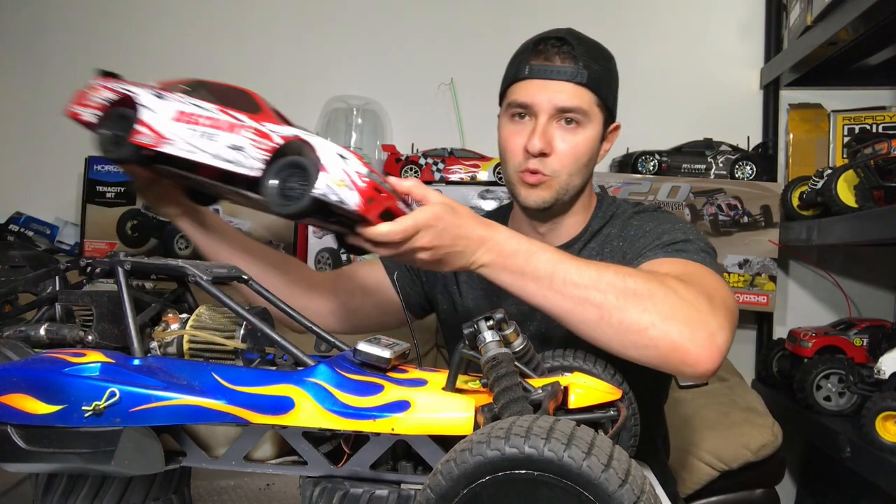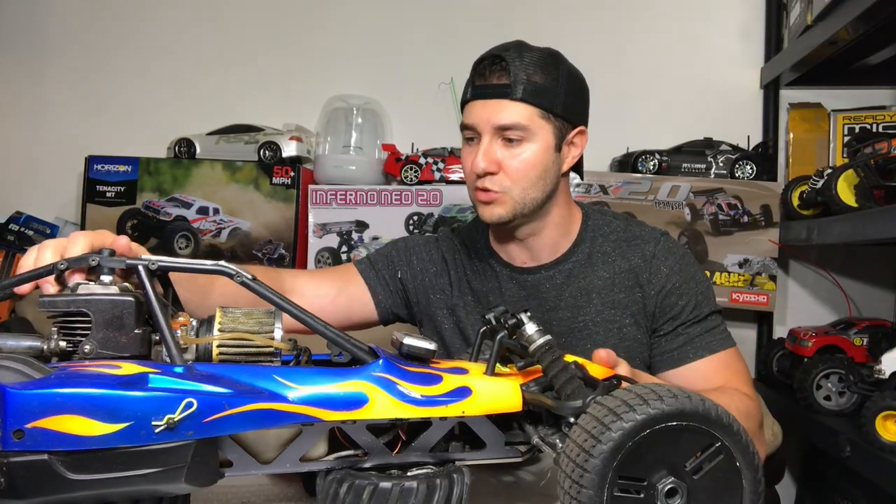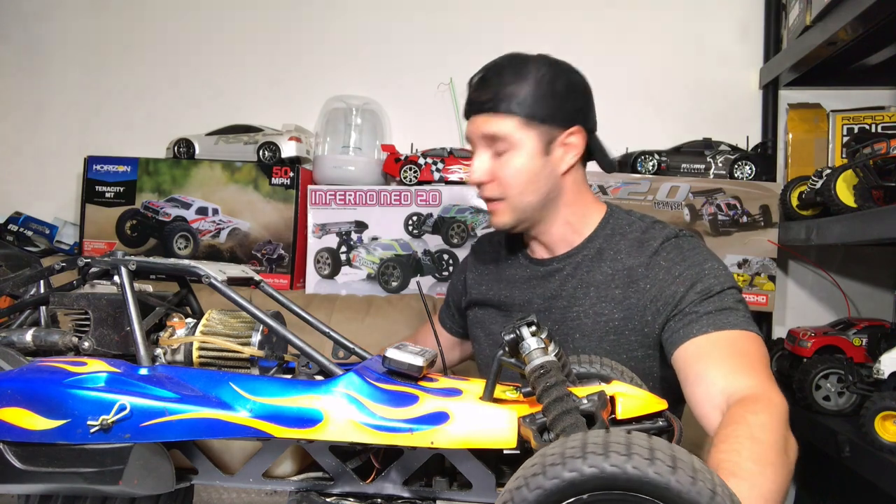The other day I was just idling this Baja and it just shut off on me. I started to worry — is everybody actually right, does this thing only last about a gallon? I paid only $12 for this carb on eBay and it's been doing good so far. But is it possible it only does good for about a gallon then dies? I observed fuel in it, so the next step of troubleshooting is to check for spark. I already had a new NGK plug in here, but I wound up having to get another one.